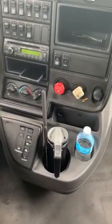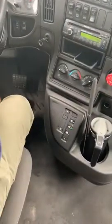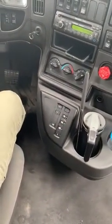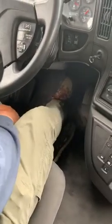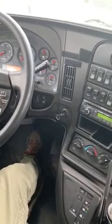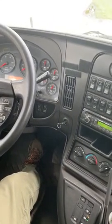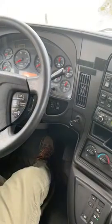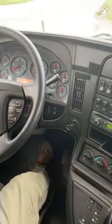So now, after everything settles, everything is good, I'm gonna count. I'm gonna press my service brake and I'm gonna hold it for 1 minute. I should not lose 4 PSI per 1 minute. Okay? Now that I did not lose 4 PSI for 1 minute, the tester is gonna tell you to continue, to go to the next step.